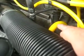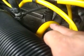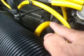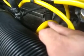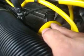There's another thing. With these silicone hosings, that main vacuum line — the one that comes off the vacuum pump — it goes to a small one-way check valve that goes to your brake booster. I don't recommend that you use the silicone hose, the vacuum hose, for that. It seems to collapse down. Keep the original; unless your original is broken, then go to the junkyard or something and get one to replace it. I've already replaced this line once with a smaller line hoping it wouldn't vacuum down, but I think we're going to head to the junkyard to get the solid line to take care of that.